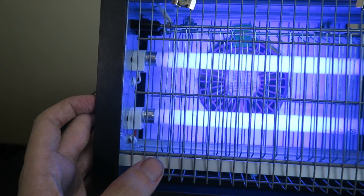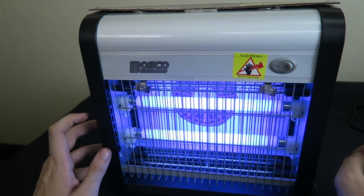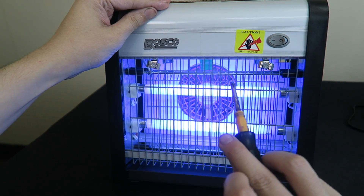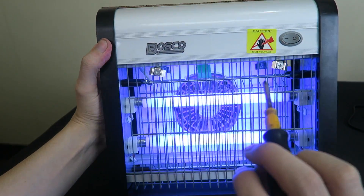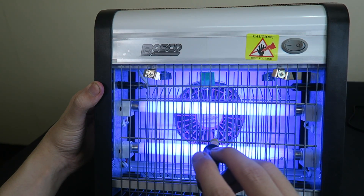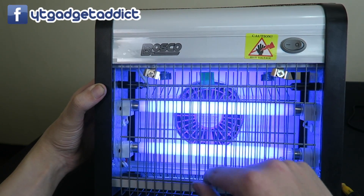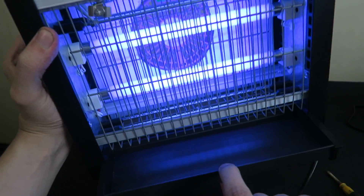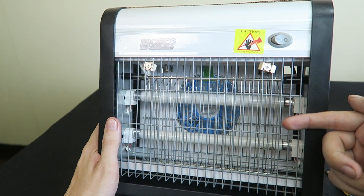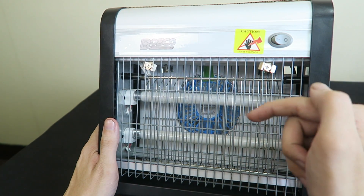You might be able to see there's a bunch of mosquitoes down there between the lines. For anyone that doesn't know how these actually work: the outside rail is completely safe to touch, but on the inside there are two rails, and when they get joined together that's when it zaps. If I use a screwdriver here — this is safe because it's insulated by the plastic — but if I put it between the two rails on the inside, you can see that it zaps. When mosquitoes go in there, the body touches both rails at the same time, they get zapped, and then they drop down into the little tray at the bottom. The mosquitoes are so tiny that as soon as they get near here, they immediately get sucked in and zapped, making it a much more effective mosquito zapper.